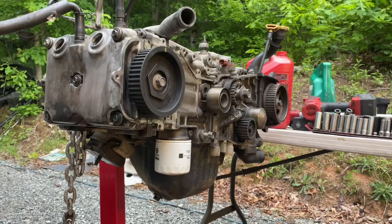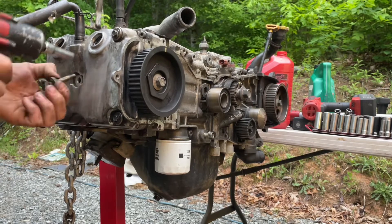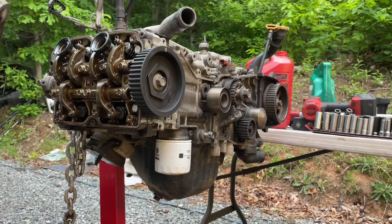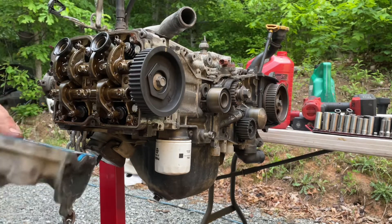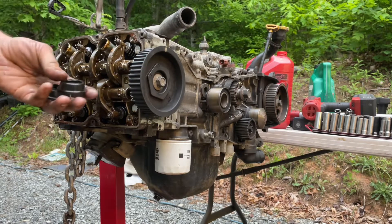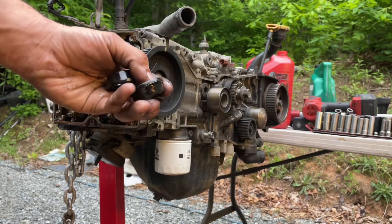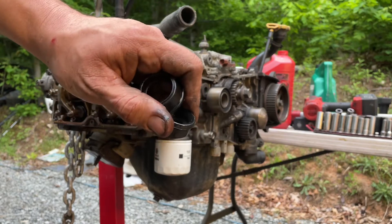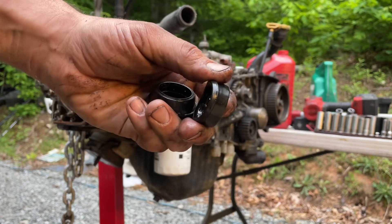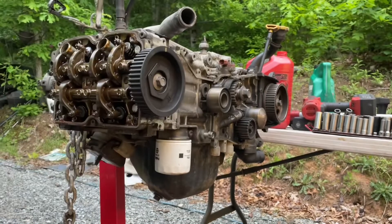Let's pop the valve cover off. Now these seals right here are bad about leaking, and a lot of times valve cover gasket sets don't come with them. The new Felpro stuff has been coming with them a little more. Keep that in mind if you take this off — mine are still soft and flexible because they're kind of newer. If you take one off that's got 50,000 miles on it, it'll be so hard it'll break. You've got to get new ones or it'll leak and you'll have oil all up inside your spark plug tubes.